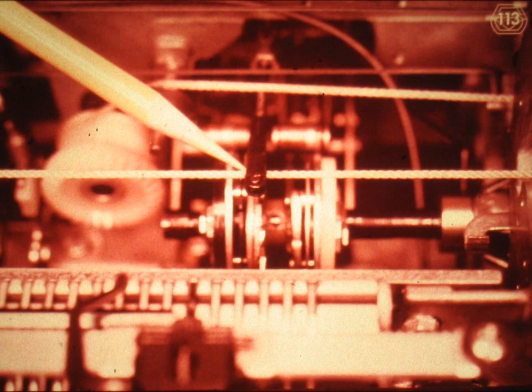Slide number 113. In order to prevent the escapement link from losing its adjustment — in other words, to prevent the clevis on the escapement link from turning — it is advisable to connect the clevis to the tabulation cord as shown here. It can happen quite easily that if a serviceman fails to do this, the escapement link is left hanging down under the operational shaft during reassembly.